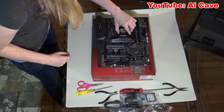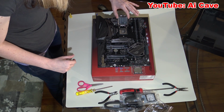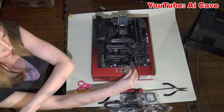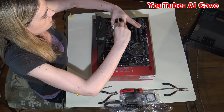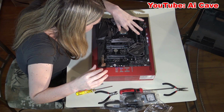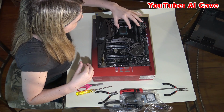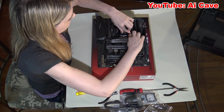After taking the CPU out of the box, I gently push down the retention arm on the CPU socket to unhinge the protective plate and CPU cover. Once this is done, the motherboard pins are exposed, allowing me to align the CPU into the socket and drop it into place. Refastening the retention arm will secure the CPU and automatically remove the plastic safety cover.